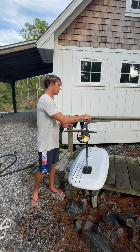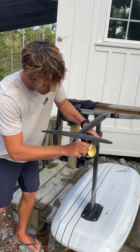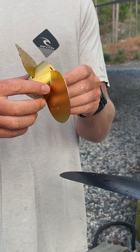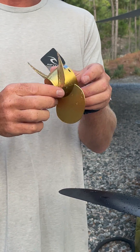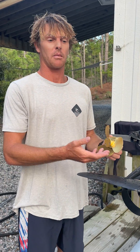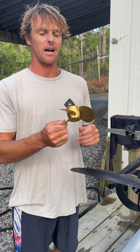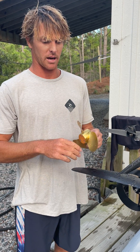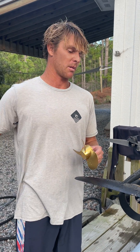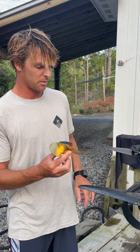What I've also found is — and this caught me by surprise — if you look at the new prop, there's a bit of a taper on the end of it. It's been tuned for a little more high-speed riding, which I was worried about at first because I thought it might not have that low-speed torque for towing someone. I do a lot of towing with the E-foil, but I've really found this to be a lot smoother, faster, and lower drag overall. I just got out of the water towing with a friend and it works great towing a second person behind the E-foil. It's got tons of power but also less drag — that kind of took me by surprise.